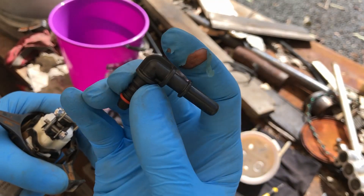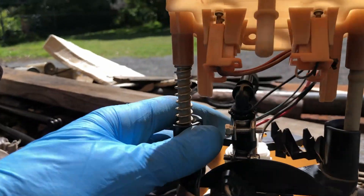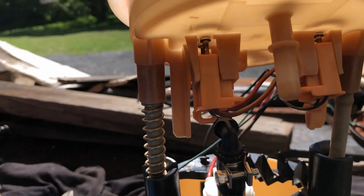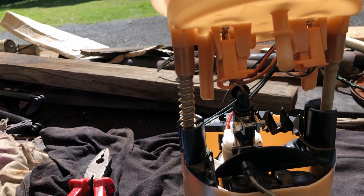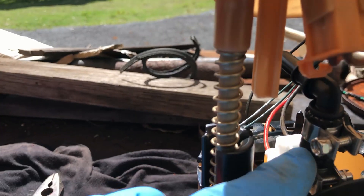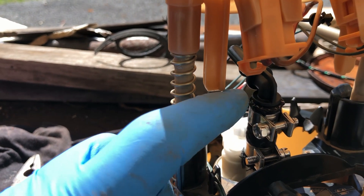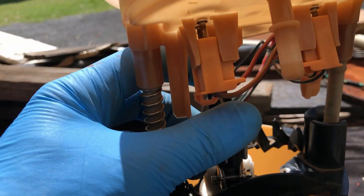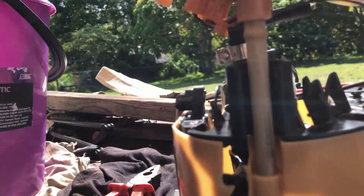The bit I'm using is just a right angle connector and this end just goes in here. I think I've got it all back together. I've angled this out that way because I think it can plug in like that. I haven't put the clips all back in yet because they're a little bit difficult to get out, so I'll leave it till it's back in the car. This is PTFE ethanol fuel pipe - it's braided. I've got my hose clamp things on there pretty tight, so that should be fine.